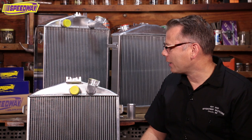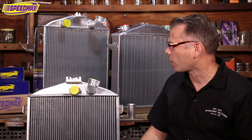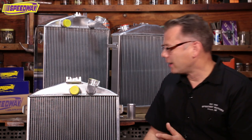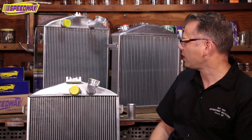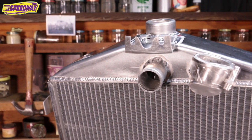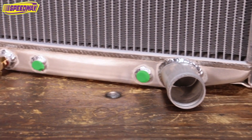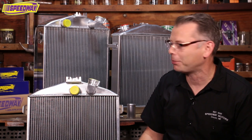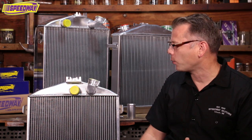That's where the Speedway radiator comes into play. This is a great radiator, and the reason I know that is because customers that buy these just love them. They never call me back with complaints — they say that radiator worked great. That's why I had no qualms about using it on my little Roadster. Now, chances are if you're running a small block Chevy, these are actually set up with necks to work with a small block — a centralized upper neck and a passenger side lower neck. I can talk about what I had to do to make it work with my Hemi, just in case you have a car other than a small block Chevy.